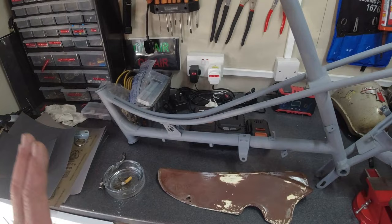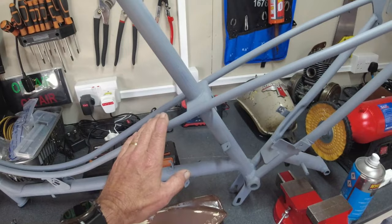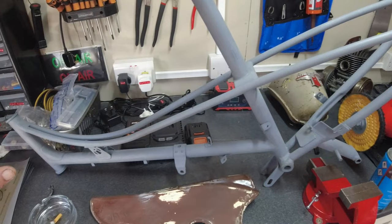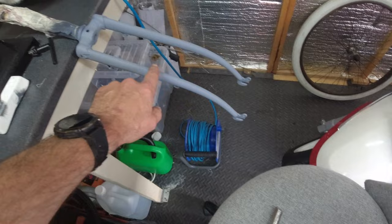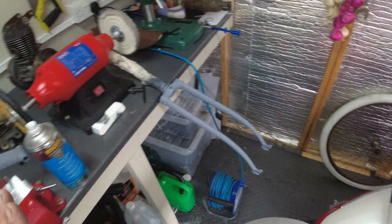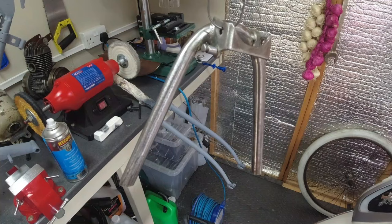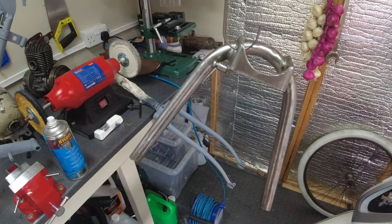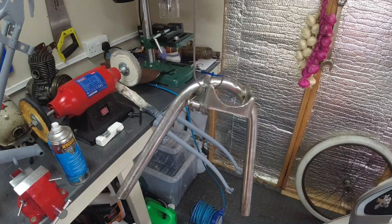That was last week. The weather's been bad and I've been at work. The frame now has etch coat and normal primer on it, and I've sanded it back as smooth as I can. Tomorrow I'm hoping to paint it in pearl gray - pebble gray actually. I've also sanded the forks down, which have etch primer and primer on them. Today I want to get the stand powder coated - first time powder coating since the fire - and then tomorrow we'll spray the frame and fork legs.